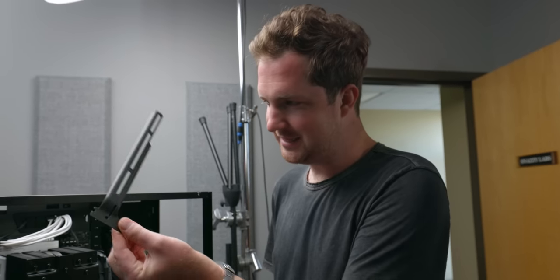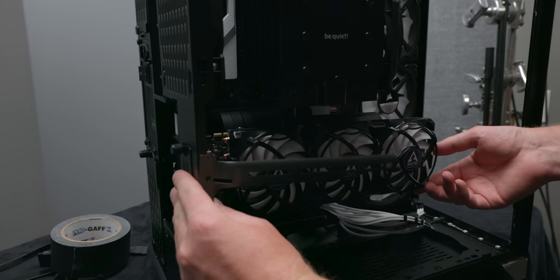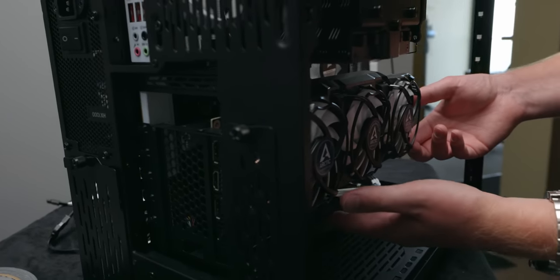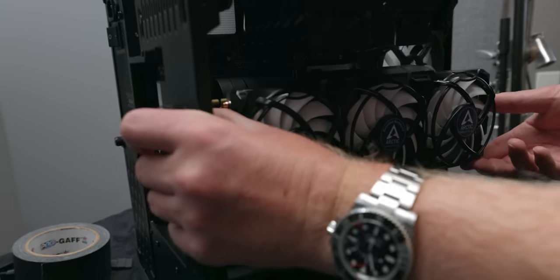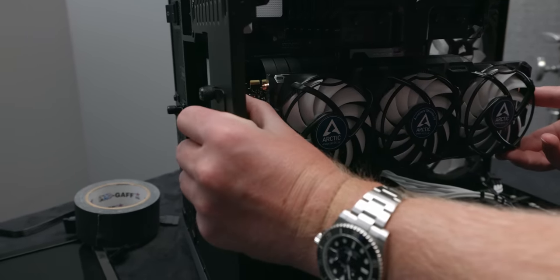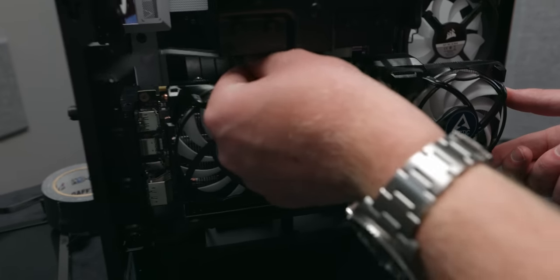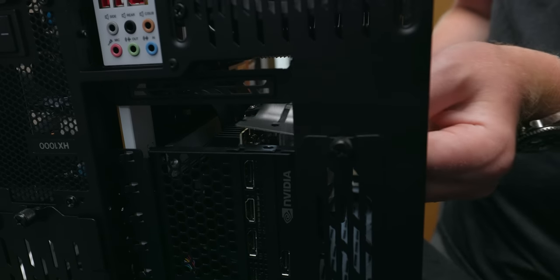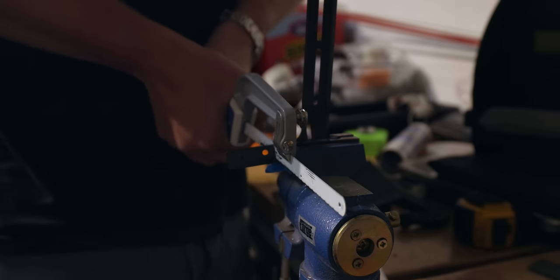There is clearance. Arctic provides this mounting plate to offset the pressure from the very heavy vertical force pulling down on the PCIe slot. Because the GPU is sitting vertically, most of that stress is handled by the L bracket. Without the stock cooler screwed into the GPU plate, there's quite a bit of bracket sag, so I need to use this support. However, the bracket for mounting is a four-slot device and we only have two slots of give, so we're going to have to dremel off two of those four slots.